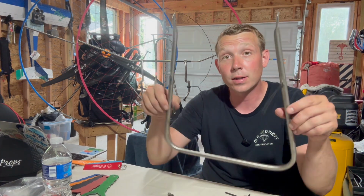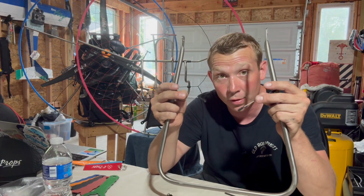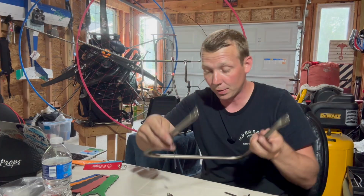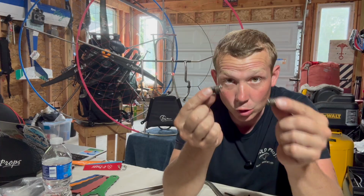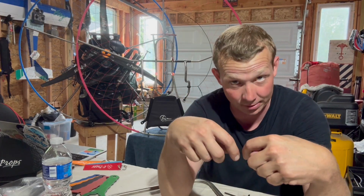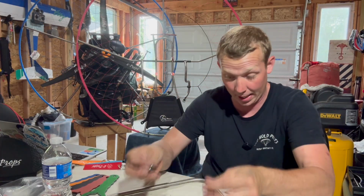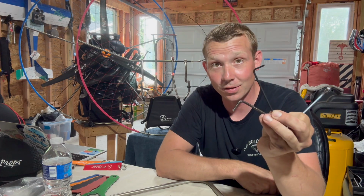And what did this require, right, to get this front kickstand off? Like I said, we had to have snips for the metal wires, for the safeties. So here's your safety wires. We also had to eliminate 2 bolts with 2 springs that obviously spring back the kickstand every time it stood up, which is a super epic design. And the only tools that this actually required was your simple 8mm and 2 different size Allen keys. Super awesome, right? Very simple kit.